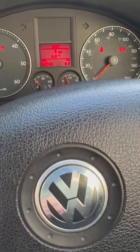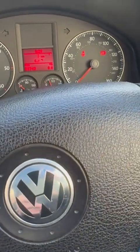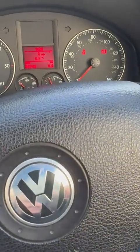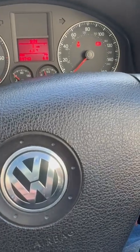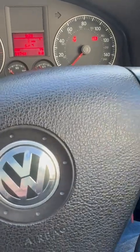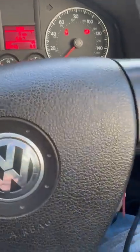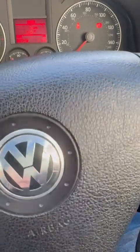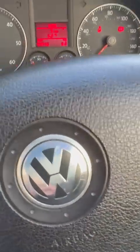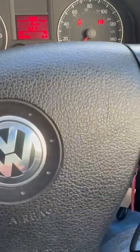Then start it up, turn the steering wheel 10 seconds to the left and hold it, then turn it 10 seconds to the right and hold it. Come back to the middle, switch it off, count to five, start it up again. Go to the left for five seconds and hold it, go to the right for five seconds and hold it, then straighten up — and all the fault lights will go off.